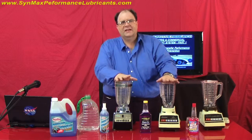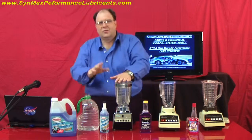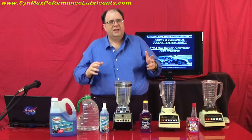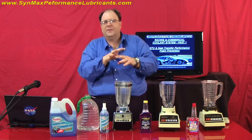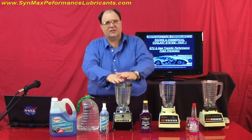What we're doing here today is concentrating on foam prevention. Why is this so important? The reason it's so important is because foam — when you have an air bubble — it has 10 times the amount of compressibility of the fluid and it causes problems. You're always going to be making air bubbles in your hot spot areas, because in an engine some places are really hot, like the cylinder head area and the exhaust area, and then other places are really cool. So you're always going to be having bubbles, and what we've got to do is try to have the chemistry eliminate them as best as possible.